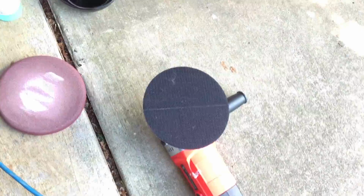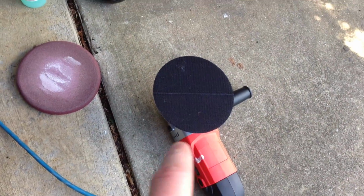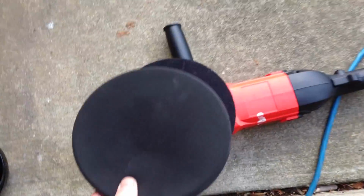Once you are done with pad number 1, your hood should start to be looking pretty good. Now what you have to do is move to pad number 2. That's the original pad. I'm going to go throw pad 2 on, which is a little bit finer, a little bit plusher, and a little bit softer. Now I'm going to do the exact same thing, a little bit less in depth, but go over the entire hood with this, and some more polishing compound. Alright, this is what it should start to look like now.